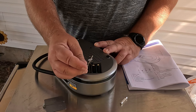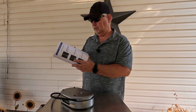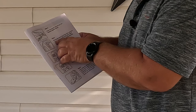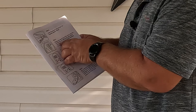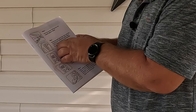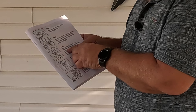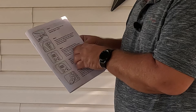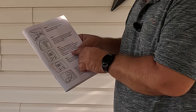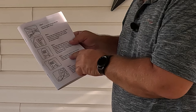All stored right here in this nice little compartment. To choose the right nozzle — we're just going to demonstrate on the car tire, so we don't need to attach a nozzle. Insert the power cord into the 12-volt cigarette lighter socket, remove the dust cap of the valve, then connect the air hose to the valve tightly. Check the current pressure first, then press the M button to choose the pressure unit, and press plus or minus to set your desired pressure. When the number stops flashing, the pressure is set. Press the power switch to start inflating.